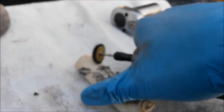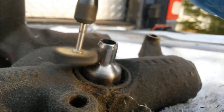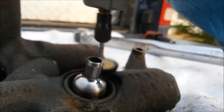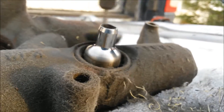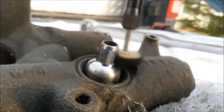Your final stage is going to bring out the shine — this is the dazzle phase right here. This is when you see that mirror finish you're looking for. If all you have is Tripoli, go ahead and just use the Tripoli. It doesn't have to be an exact mirror finish — you just want to get out any uneven surfaces. You're looking to make a nice smooth sealing surface, not necessarily be able to see your reflection in it. This is where it starts to shine.